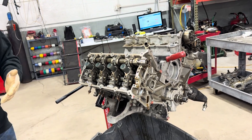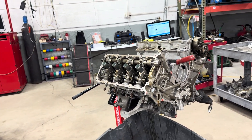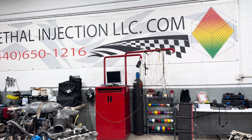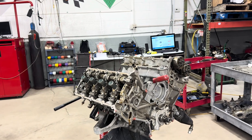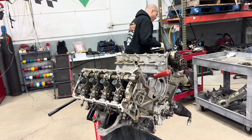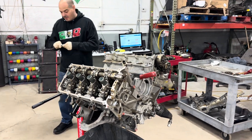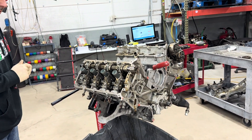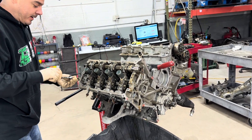Why would they be mad at me? Because the new Z06 motor — the new Z06, 5.5 liter flat plane. And obviously if that's a problem, you just get rid of that because they get 90 degrees — just like the Ford guys do. They have bigger bore centers, which means bigger bores, which means the valves and the cylinder heads are bigger. And on top of that, they don't have this rocker roller follower deal — it's just a straight camshaft, DLC lash cap, valve.